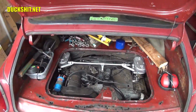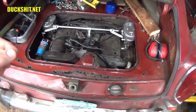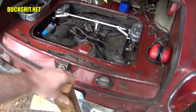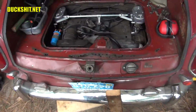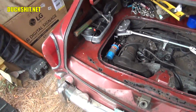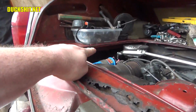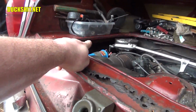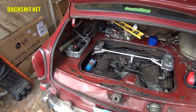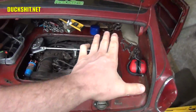One of the first ones, and people said this more consistently than anything else, is put a floor jack under it and use a piece of wood. Put that up underneath, hit the trunk from the underside, and just jack it up. Well, that might be great if it was just a flat piece of sheet metal, but it's not. There's multiple layers, and you see it? It's boxed. So even if I were to do that, I would just crush the underside. And the underside isn't where the problem is. The top is what's bellied, and the flange is what was crushed inwards.